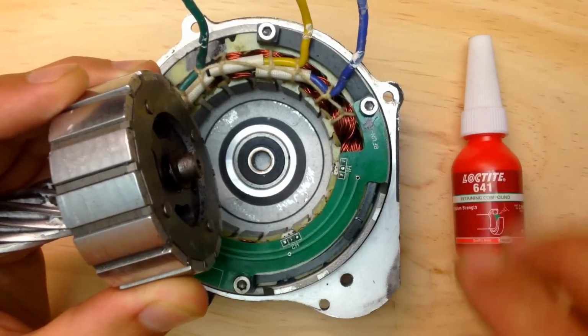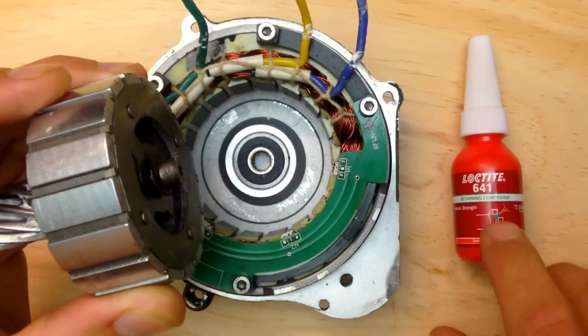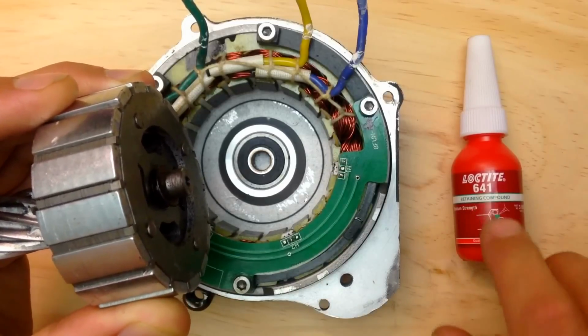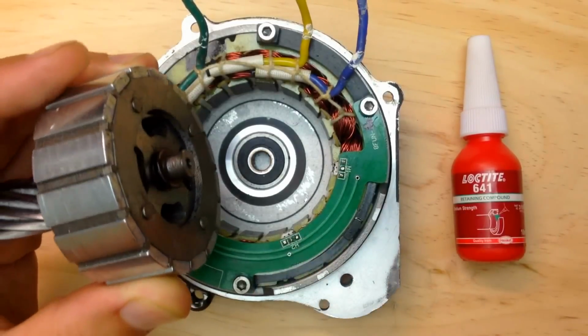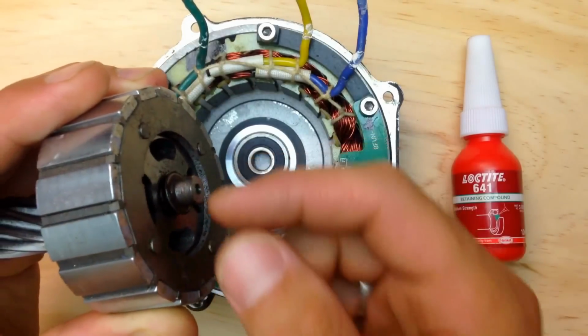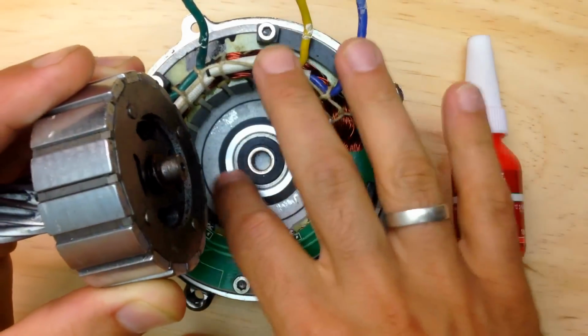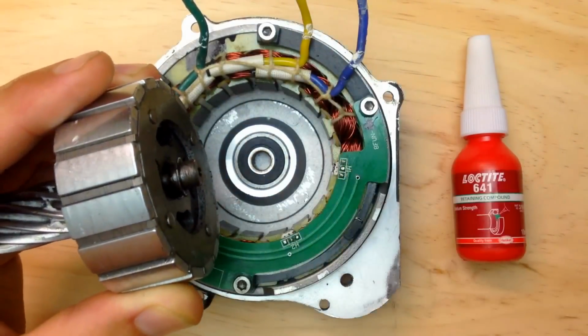do a Loctite procedure, right? So I have a video linked in the description below, and we're going to be showing this. Loctite 641 is actually designed for this particular case, okay? So it's actually like a glue or rubber, and you're going to make this thing grip inside here and spin properly without sliding metal and causing a lot of friction.